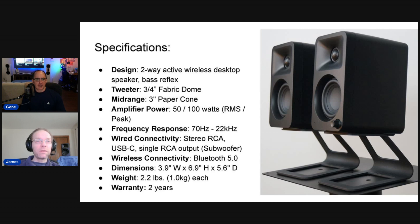That's a pretty cool feature to have on a little speaker like this. When you use the subwoofer output, it actually bass-manages the speaker — it senses the connection and automatically high-passes the speakers to 100 Hz. That really gives those little three-inch woofers a break.